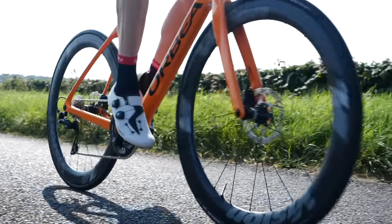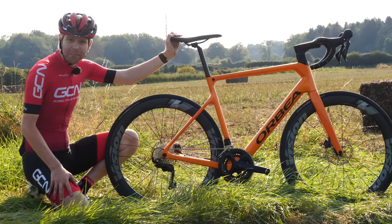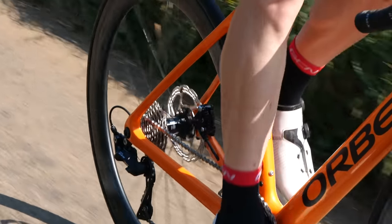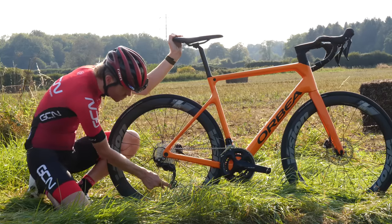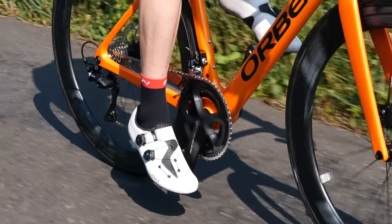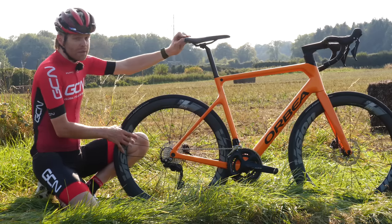It's also designed to be less prone to slapping and crashing into the chainstay and damaging that as well. Again, something that's come from mountain bikes. And also you'll notice this massive long cage on here, which I said previously can accommodate up to 34 tooth cassettes. And allow me to tell you about the front mech as well, because that's really cool.